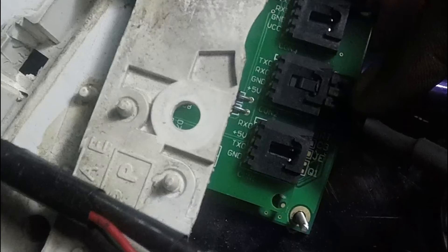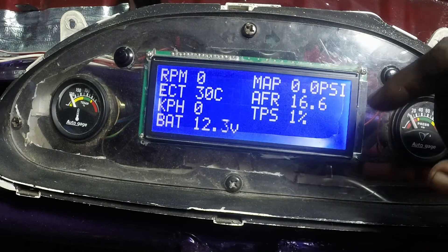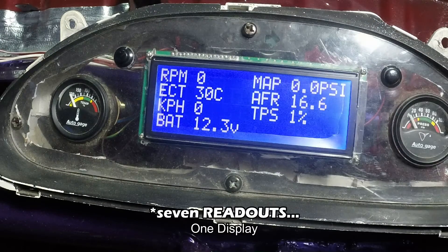It's not really just a plug and play. If you don't have the pins wired out correctly, you will run into problems where the screen will just turn on dim, or it might just read 'connecting.' Here you can see I have seven displays on this screen, and I have this as my primary screen. These buttons up here allow you to scroll through the screens back and forth.